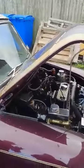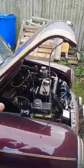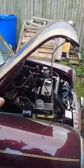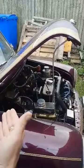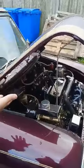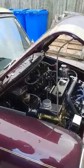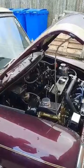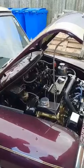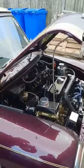That's it idling on its own from stone cold. The idle will always be lower when it's cold because we have a 1000 RPM target idle speed for this engine. Because we don't have an idle air bypass system, we use algorithms in the ECU to add spark into the system and jack the engine speed up when cold. We're looking at cooling temperature, and once that starts to come up, it will stop adding additional fuel into the base map.